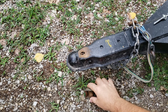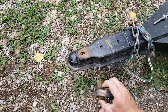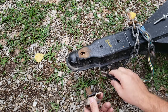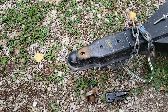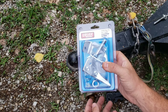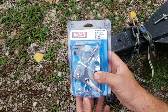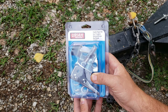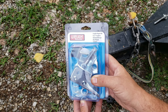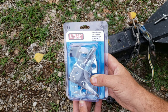Hello YouTube. Today we're going to be doing something a little bit different. I went to get out using my trailer this morning and the coupler, or the trailer tongue, broke off the tongue of my trailer. This is just something that can randomly happen to any trailer, but it's an easy fix. You don't need to replace the whole hitch. I was able to find a coupler repair kit for two inch couplers or balls. They're fairly inexpensive and really easy to fix. If you find yourself in a similar situation, there's really no need to cut the tongue off and repair the whole tongue — you just go get one of these coupler repair kits and you should be up and running in no time.